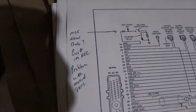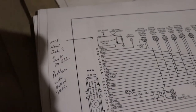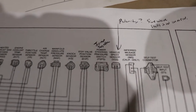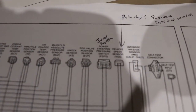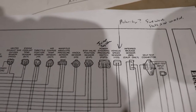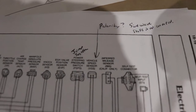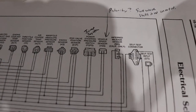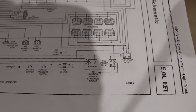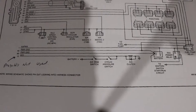This is an automatic so it has an NDS. There's a diode — my understanding is that it's actually inside the computer, so you don't need to worry about it. I'm not going to use power steering, so you need to jump the power steering signals together because that pressure switch opens under high pressure — which would be a high load if you're stalling out the engine on the power steering pump. The vehicle speed sensor outputs a sine wave as far as I understand.